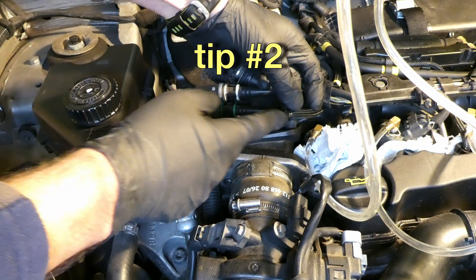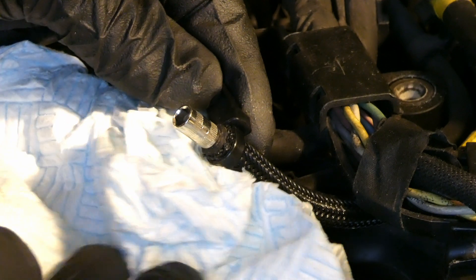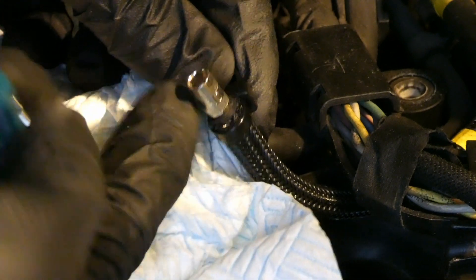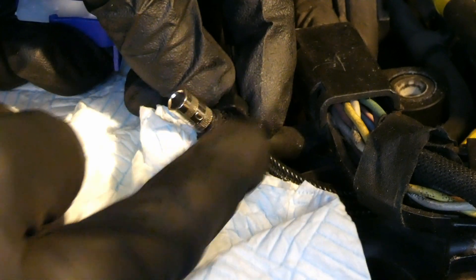One additional thing: this is the return pipe — you have to block it because it will leak and start weeping fuel. That's why I had a tissue there, but it doesn't weep anymore. I plugged it with one of these — I have a link in the description — and tied a zip tie around it so it doesn't leak. In my original video I used one of these blue things but it was always leaking. Stick something in there, zip tie it and this won't leak.